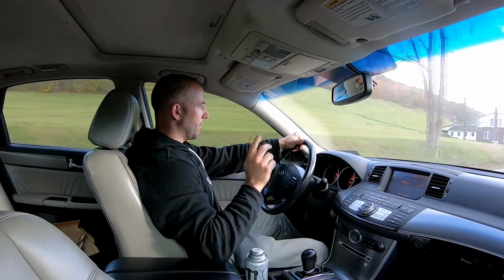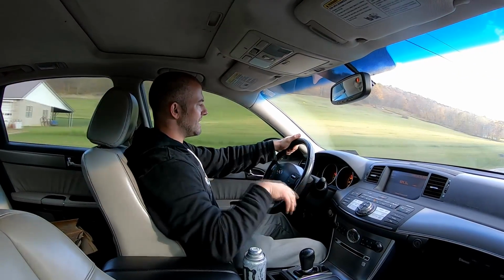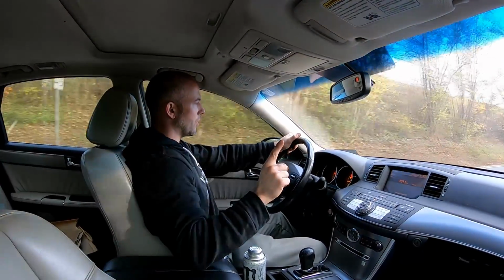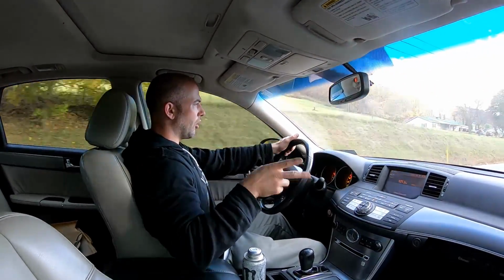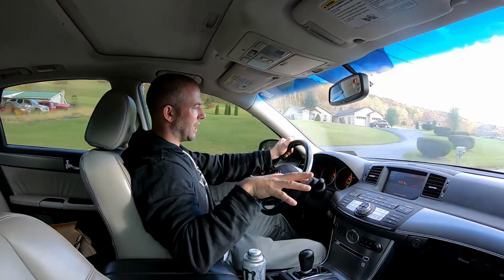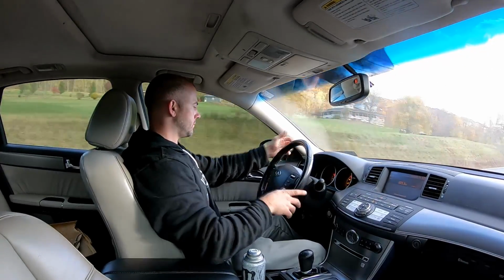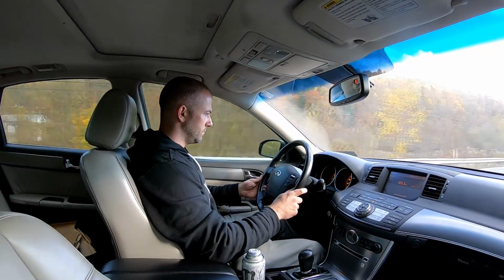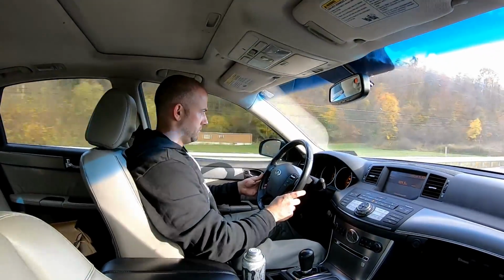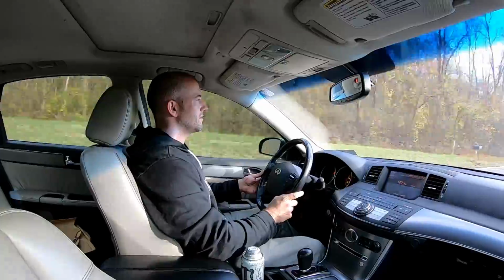But we have a RAS light, VDC light off, and a slip light. So traction control is not working. And I think RAS is the rear steering, and the ground wire off of that I don't have hooked up. So that could be that issue. It sounds so good. So good.